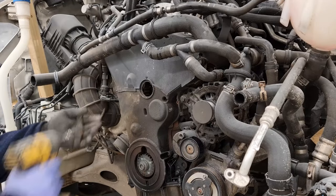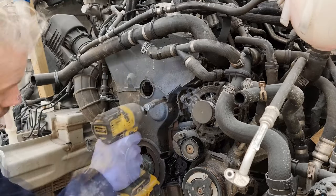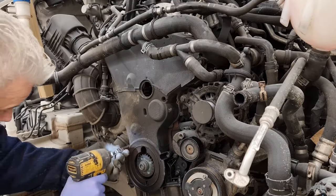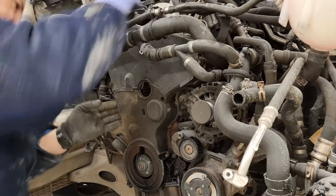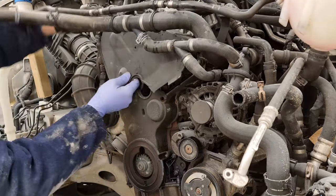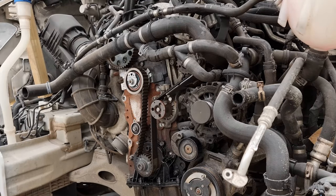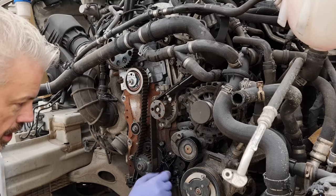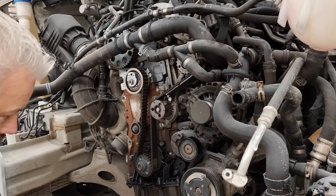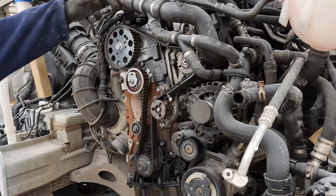To get the cover off, we've got a T30 Torx here, and then another T30 Torx here. This is the timing belt. And basically, I think from where the van had the accident, something probably got pushed into this plastic casing. The crank seal itself literally is just plastic on the casing — nothing very strong — and it's just held on with these little 10mm bolts.